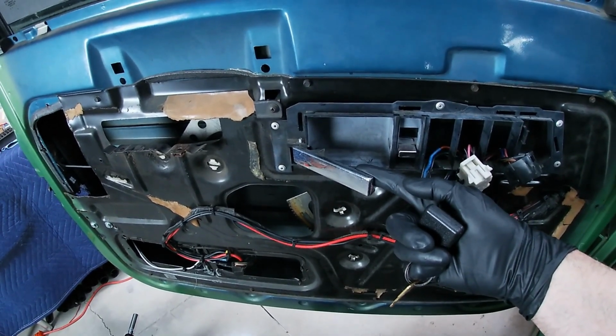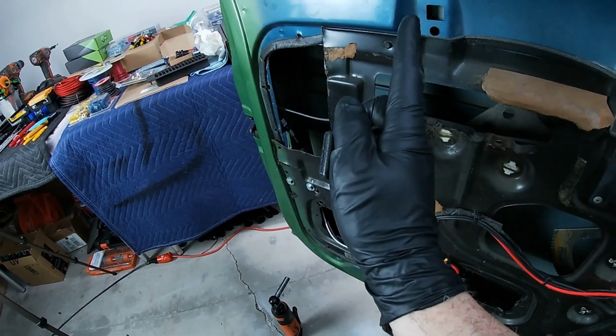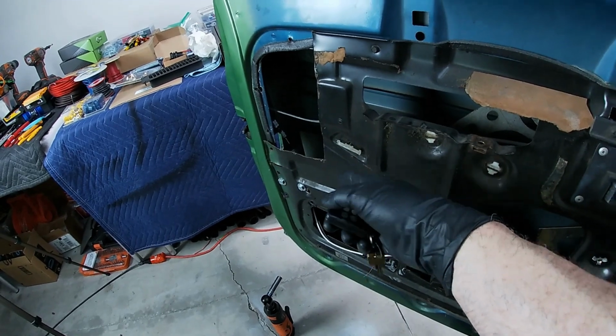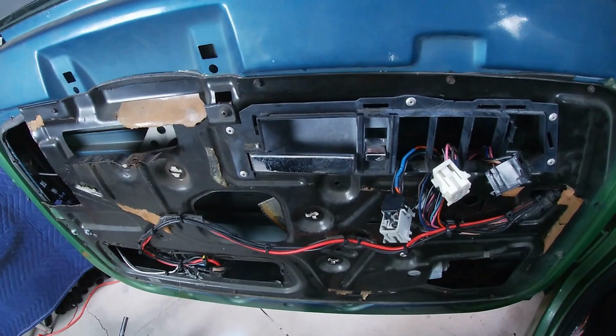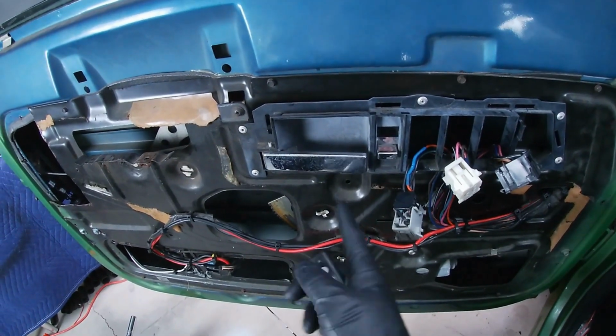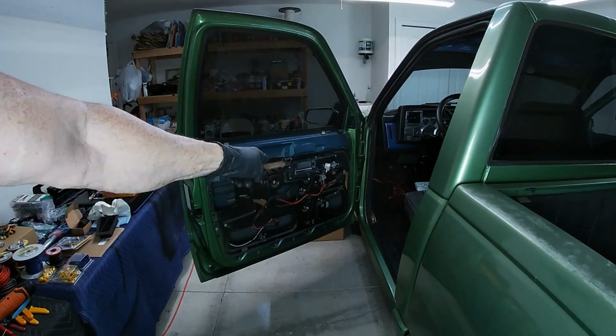They would pop open and they would work, but there was too much tension on the solenoid in here, and there was too much of an angle on the solenoid. So eventually this solenoid burned out. I just replaced it. But now, when you lock and unlock, notice how it goes right back where it should. Finally, let's get this door panel back on. This one is done.